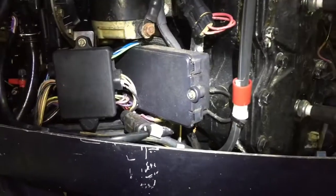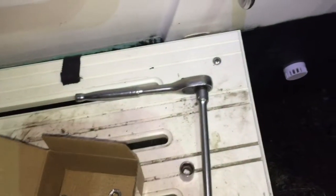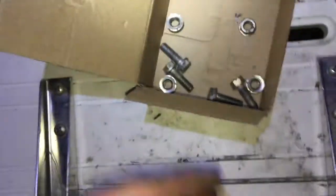On this Johnson 130, I decided I was going to pull the carburetors. You're going to need some basic tools — two sockets: one is a half inch and the other is a 7/16. You've got four on each carb stack, and each carb stack is two carburetors.